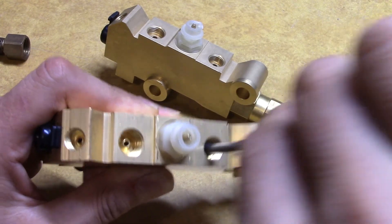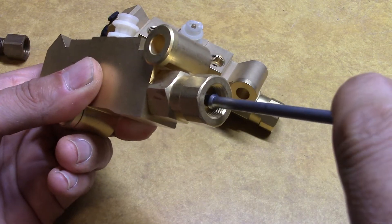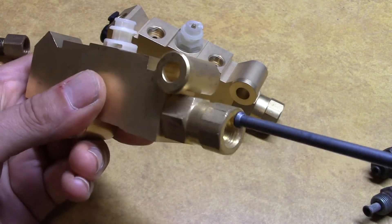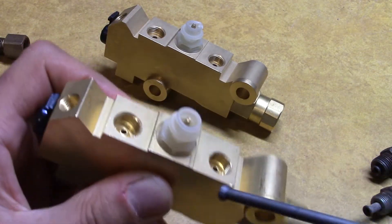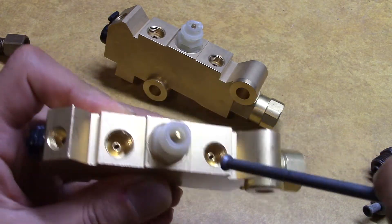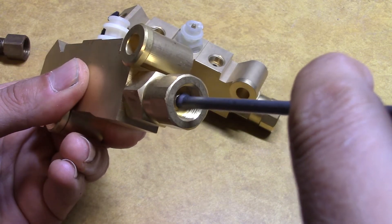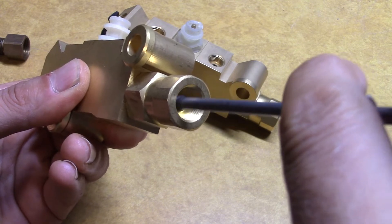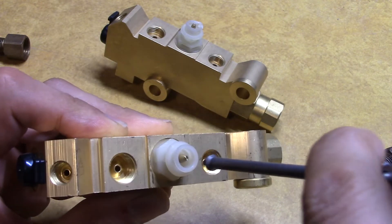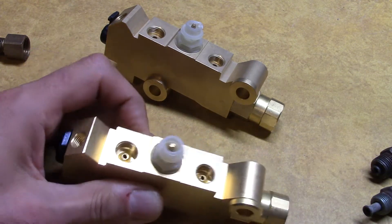You put that on a cone — that feels good. You're going to use that back here, it's going to sit on top. Of course, you use the correct size nuts because each one of these ports has a different size nut. You get the big nut for three-sixteenths line and that's how you would assemble it. But my argument is: that doesn't seal — it doesn't even sit, it slips all over. It doesn't lock on it like it does when you go to the cone in here.